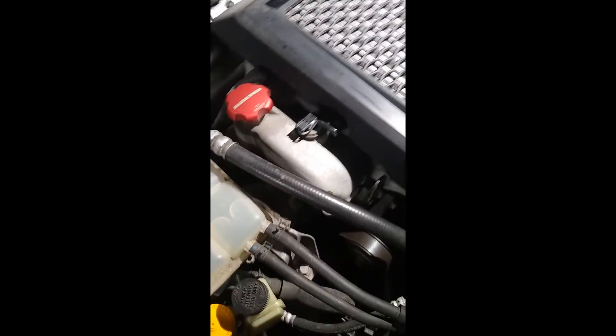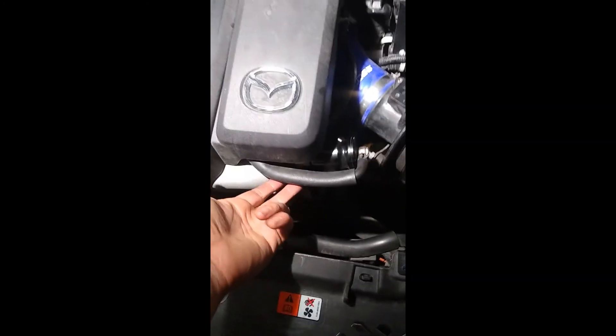Got the Speed 3 back together. Once we got those spark plugs in, it was real straightforward — slap the intercooler back on, tighten it back up. My only word of advice is make sure you're not pinching any hoses, do a once-over, make sure you get all your clamps in place. Don't over-torque anything — just use a little quarter-inch driver with a small socket.